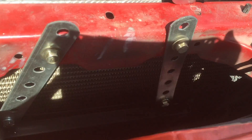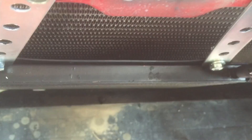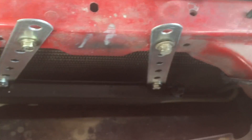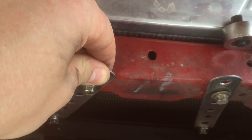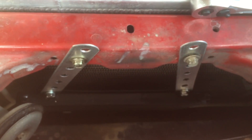We have our mounting point for the cooler. Pretty simple — just resting on the AC condenser line down there, and mounted up here to the same points as the hood latch. I've got a little extra bracket material for securing other stuff, zip-tying lines to whatever else I need to do up here, so I'm not going to trim those off quite yet.